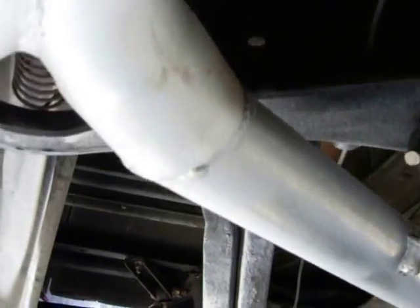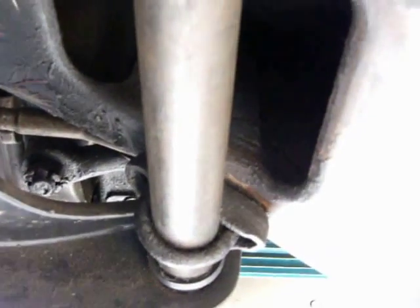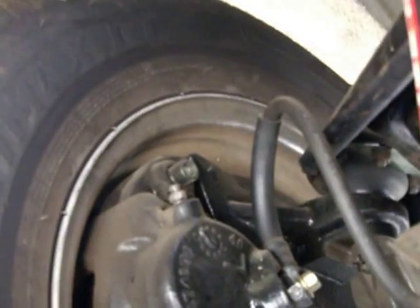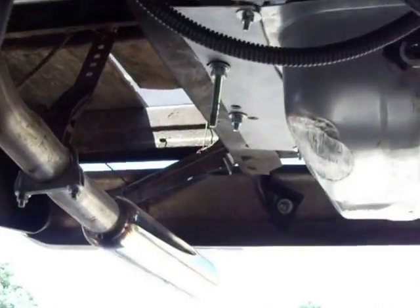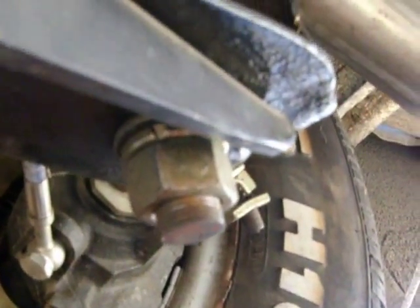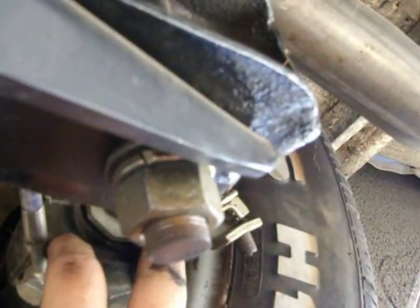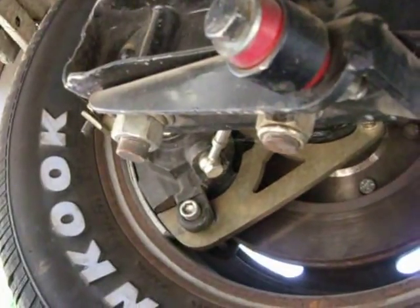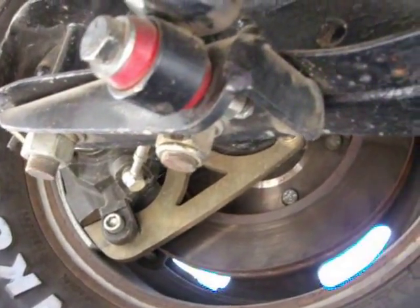Anyway, so that's a 3-inch spring drop in the back. I said 6102-2 CPP classic drop springs in the front, and 2.5-inch drop spindles from McGaughy's with 4-wheel just stock GM disc brakes. And the back are GM, I believe those are off of a Cadillac Catera or something like that, they told me. I can't remember what they said. Or DeVille, the later model ones. And then GM 6 lugs. 3.73 True Track locker rear end from Eaton.